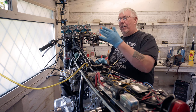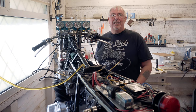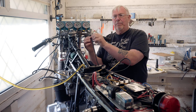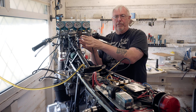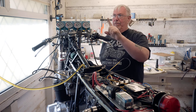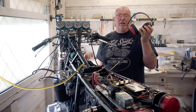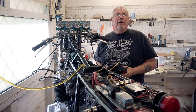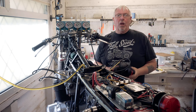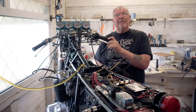The gauges are rigged up and I can now use the choke as well. Usually you would warm the engine well through before balancing, but I'm doing this to try and find out what's happening with the second cylinder, so I do want to start it on choke. All I need to do now is add fuel, connect the battery, light the blue touch paper, and we'll see what happens. The carbs didn't leak - hey, maybe I'm getting better at this! I've twiddled the dampeners up so hopefully nothing should register at first. I'm running it inside - I know where the combustibles are, got a fan to draw air through. No silencer, so I'm taking my hearing protection very seriously. If it gets very smoky you've got danger with your lungs, so you should wear a mask.